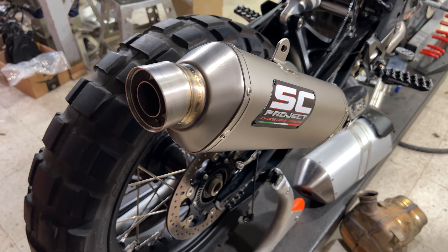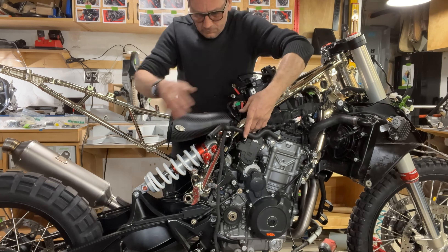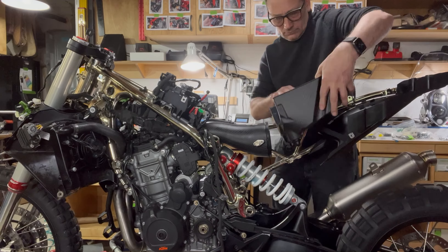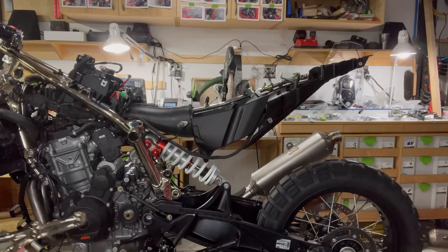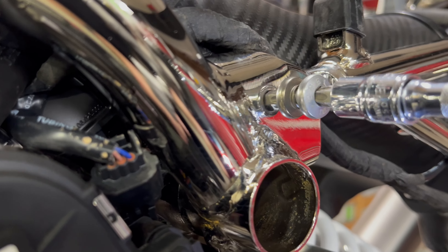We're going to take that out. A lot of the things I'm changing on the bike are intake and exhaust. Since the engine is an air pump, all it can do is suck in more mixture through the downstroke of the piston. The more it can bring in, the more power. Anything you can do to reduce the restrictions is going to give you more power.